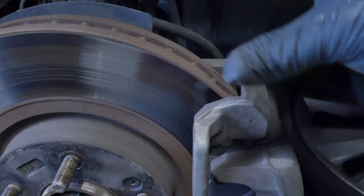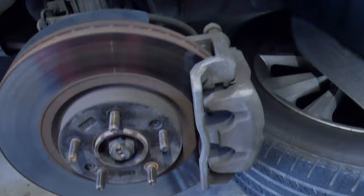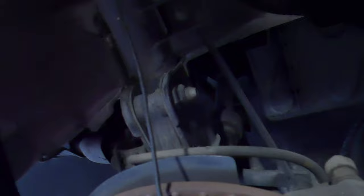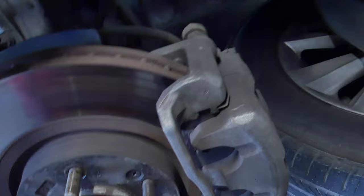You do have to remove the whole brake caliper bracket - that's probably what it's called. We'll probably need a rubber mallet to hit the rotor off. I have a little cable so I'm not just leaving the brake caliper hanging - I don't want to put strain on the brake line. I'll tie the caliper up somewhere so I'm not straining the brake hose. So I'll take off the brake caliper, then the brake caliper bracket, then the screws, and go from there.